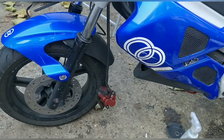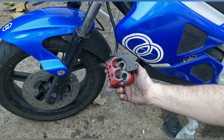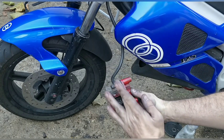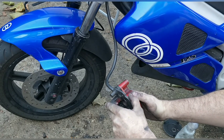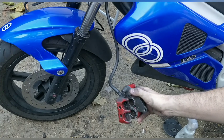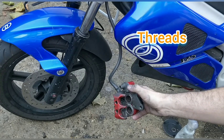Carrying on from where Rabjab left off - he was doing a great job. We pushed the pistons back, gave everything a clean up, freed the floating arm so it now swings out and forward, then we slide the new pads in. That part's very easy. Just a tiny bit of grease or WD on the pins.